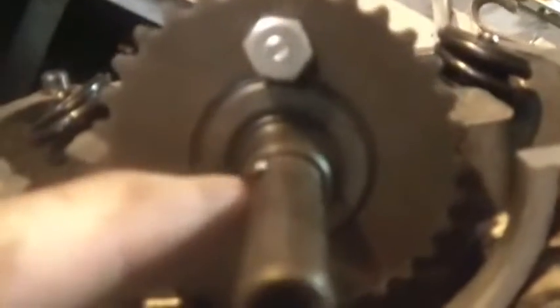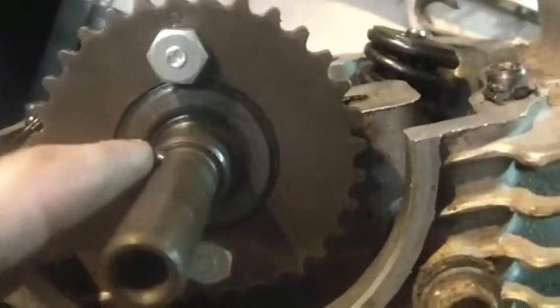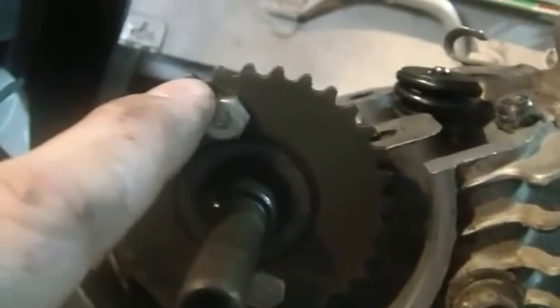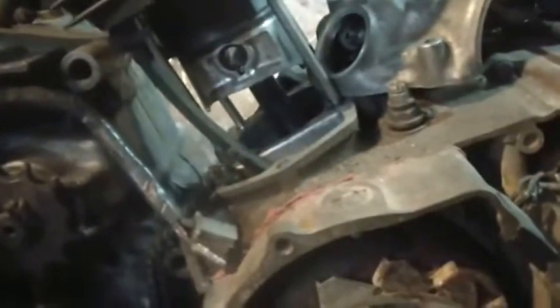You can see the little divot off to the side there — that's a little bit further this way. That's how you know you're at top dead center. So: lobes down, circle up, and you should have that divot off to the side. Now you have the engine valve timing correct — your valves are all proper and everything is kosher.